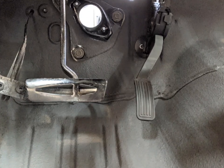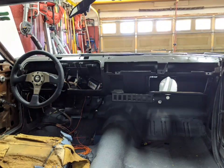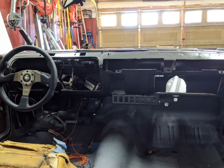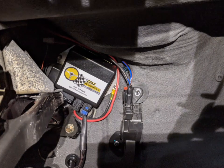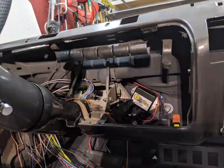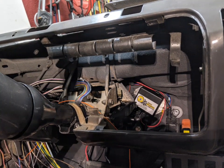Here's the gas pedal, I guess you'd call it. I was able to use existing holes in the firewall, so no drilling — I just added a couple of riv nuts. Along this whole process, I've tried to not drill as much as possible. This is the controller for the electric power steering rack, and it fit right in the bolts where the bulkhead wiring used to pass through the firewall. I needed to patch that hole anyway, so this worked out perfect.